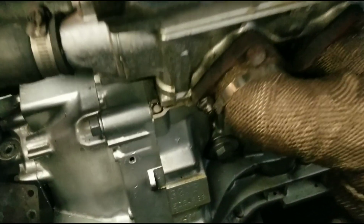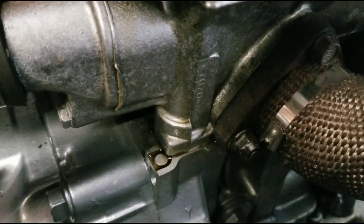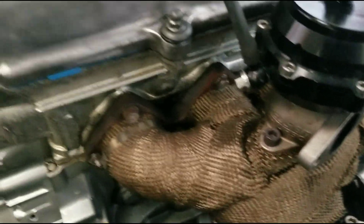The spark plug wires say 'suppressor' on them but this one looks like it's kind of falling off. You always want good quality parts, especially when it comes to ignition. We'll pull the spark plugs out shortly. The oil leak we saw down below looks like it's dripping down the block — could be an O-ring, hard to say.